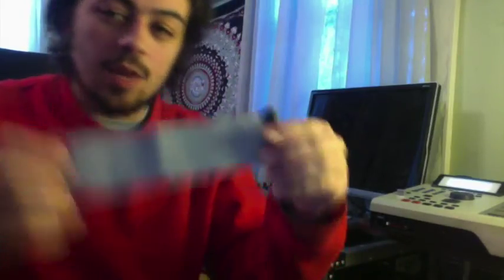It's really easy. Next thing you're going to need: IDE cable, 40-pin, female to female. At least 6 inches to get to the card reader. 40-pin is going to be great. If it's 39-pin and has one of these little holes blocked, you can get a drill bit and pop it through. But 40-pins are like $5 on eBay. You can do this whole thing for like $30.